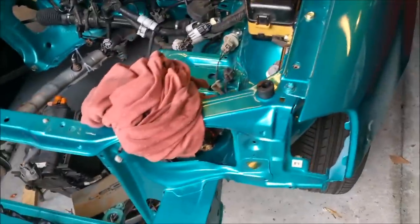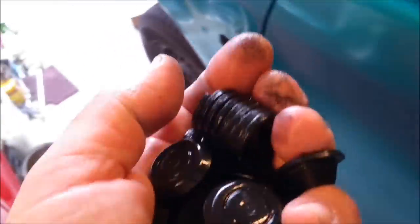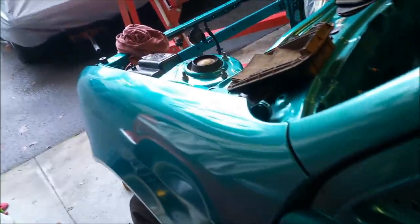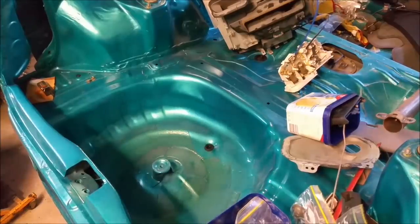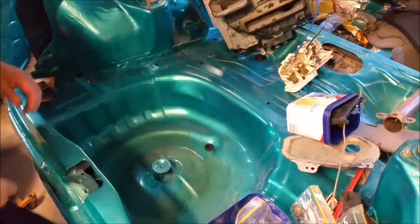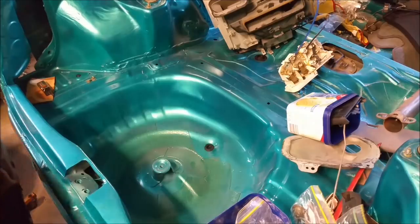There are a whole bunch of grommets. There's big rubber ones for draining the floor if there's ever a mishap inside the car and the car needs to be drained, these ones here. And there's also a whole raft of probably 24 stick-on grommets. The purpose of those is that the sills under the doors are opened up so that the dipping solution when the car's manufactured can enter and then drain out when they're finished immersing the car.